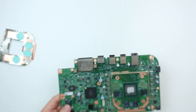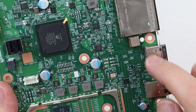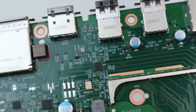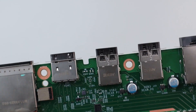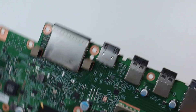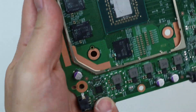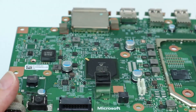Zooming in a bit more: in terms of layout, the HDMI port runs through some filters and into what I'm presuming is a retimer chip just there - I can't quite read what chip it is, but it's a retimer chip which then runs through to the APU, which includes the GPU. Interesting stuff. One of the things that used to have problems on the old S was power, so it looks like we've got a power controller IC over here - most likely there - which is obviously regulating the power. Very interesting.